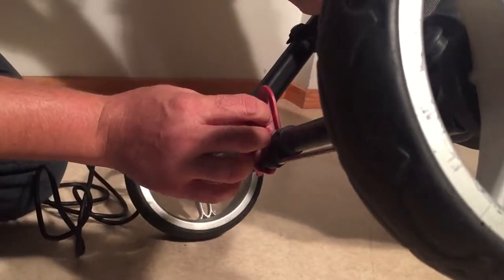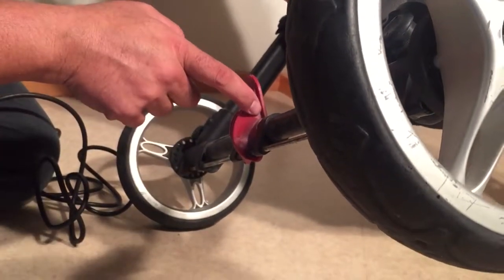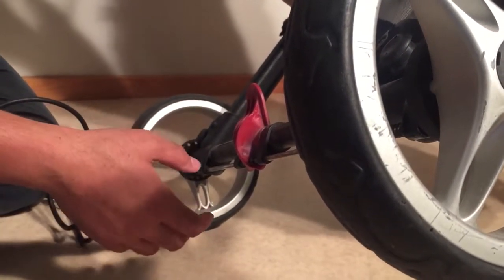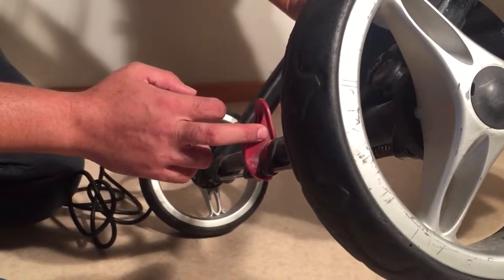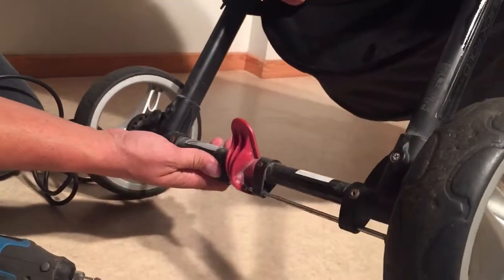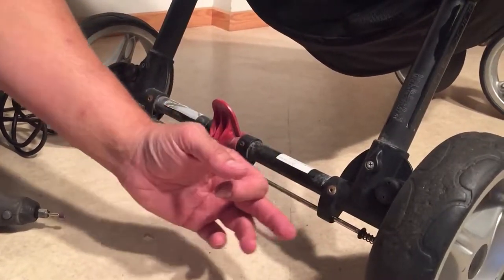You're essentially just turning this again into a fully circular valley with enough depth that the end of the bar can't just pop out and slide. So that's how you would repair this pedal if you're having trouble with the brakes staying applied. Otherwise, it's really a matter of keeping the brake bars rust free and keeping some sort of lubrication into these areas where the bar slides through.